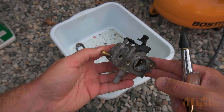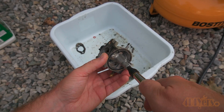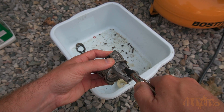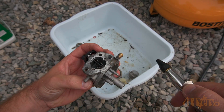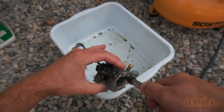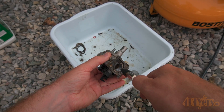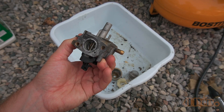Once done here you can see the carburetor is greatly improved. Sometimes I do recommend using compressed air to clean out any ports where debris or water may be left over. If you do find an excessively plugged port you can use torch cleaning tips to help break any debris away. However keep in mind that they are abrasive and may open up small orifices which you don't want — this can mess up your air fuel mixture. After that the carburetor can then be reassembled and reinstalled back onto your small engine. If you have any tips for carburetor cleaning with an ultrasonic cleaner please be sure to share them in the comments below to help out fellow viewers.